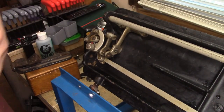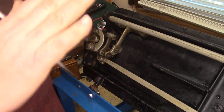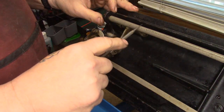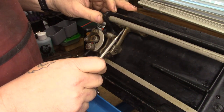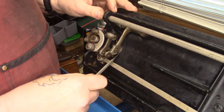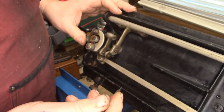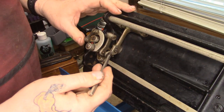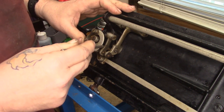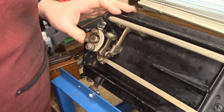This is an as-found 66 Red Eye, from around 1915 or 1916 — pretty old and pretty funky, but we'll deal with the filth. The shaft across the top is your feed dog rock shaft. What that's doing is making the feed dogs go fore and aft inside the needle plate — it has zero to do with the up and down motion. What controls the up and down motion is this shaft here: this is the lifter shaft.